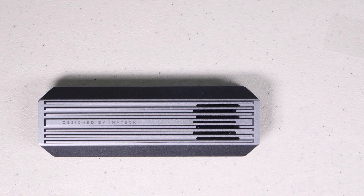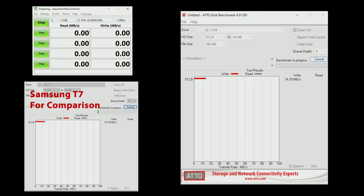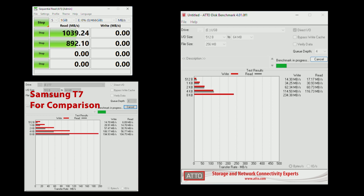That's pretty much it. Now that we've seen the hardware, let's put it through some testing. For the testing I'll be using a Samsung 980 NVMe drive as my base drive, with the supplied cable and a Core i7 PC. Since internal temperatures of the drive can't be measured via USB enclosures, temperatures were taken with an IR temperature gun on both the front and back of the unit. These results are shown alongside a recent Samsung T7 comparison.